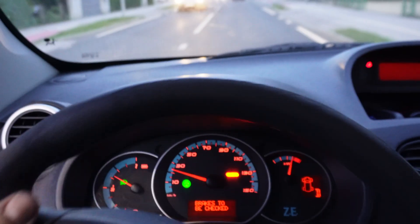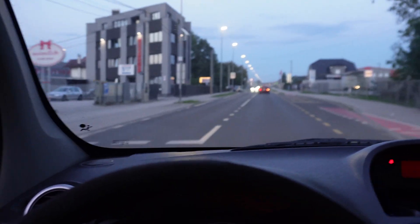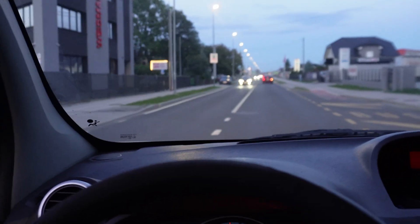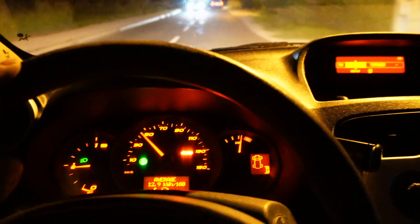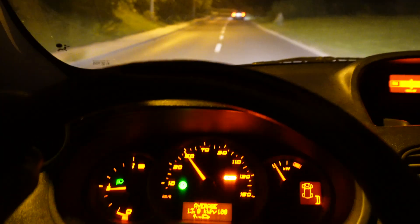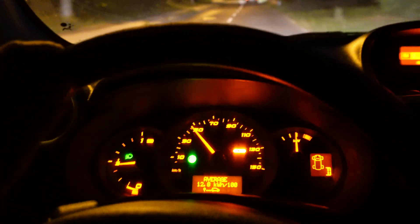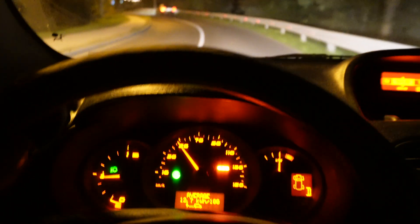We hope the customer will be very happy. I must say I'm really impressed with this car — there is no better substitute for commercial use. But during the test drive you can hear something on the right side of the car. It has an issue with the Q210 drive unit. I will need to inform the customer that he also has issues with the rotor bearings and gearbox bearings, so we will need to remanufacture the electric motor too.